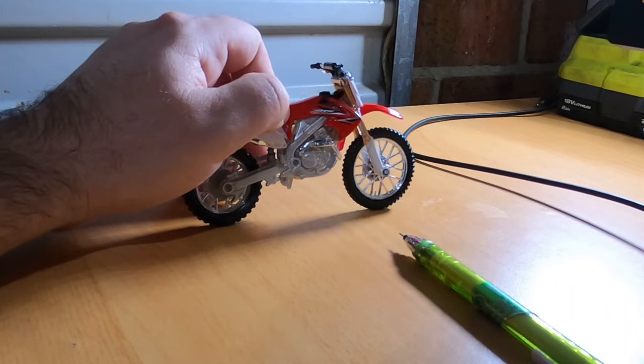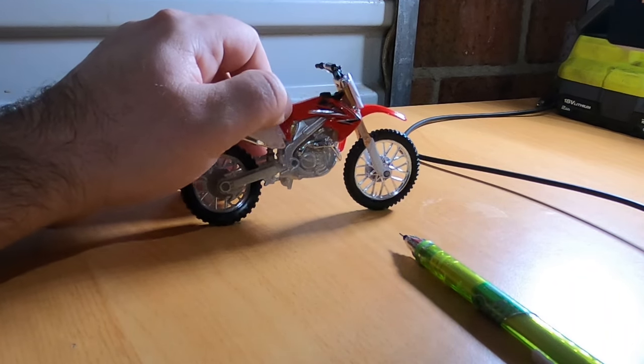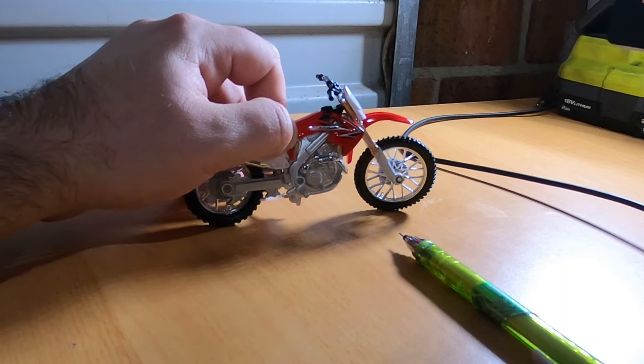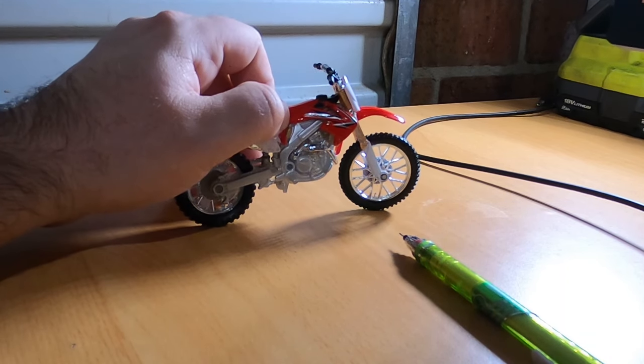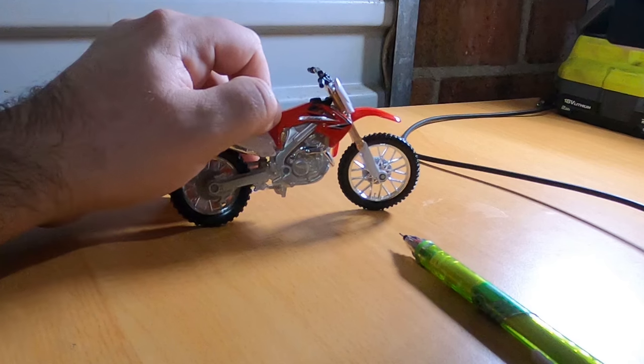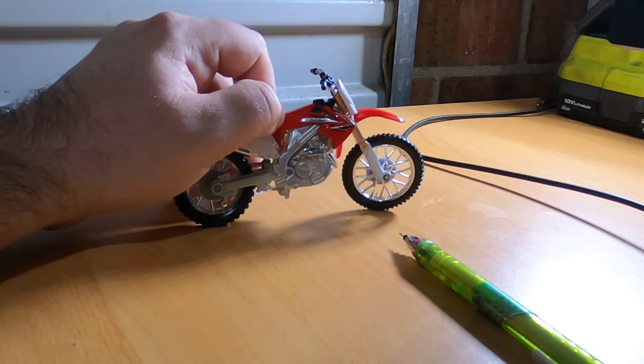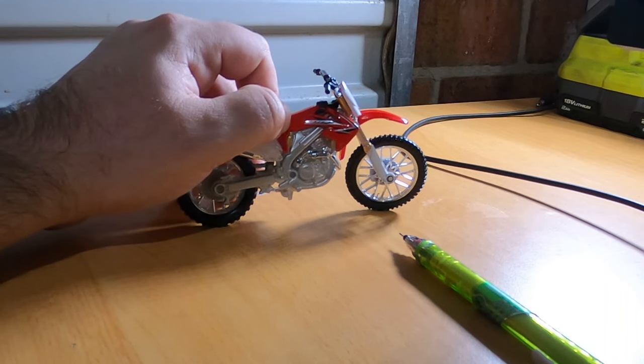So if I don't have any preload — if I've got my suspension fully wound out — and I'm 100kg and I sit on it, the bike's going to go down and sit at, say, 50% — 50mm of movement. If I wind up the preload so that the spring is tighter, but it's only preloaded to 80N, so it's still tighter than before, when I sit on the bike it's only going to need a little bit of distance before it reaches that halfway point of the spring. Because it's already preloaded, say, 40% down, and then when I put the weight on it, it's going to go to that 50% point, which is 100N.